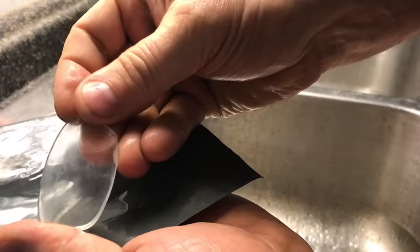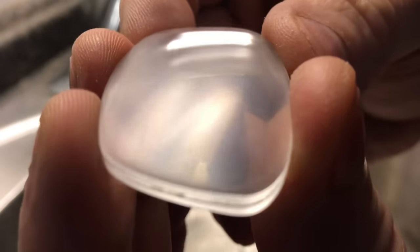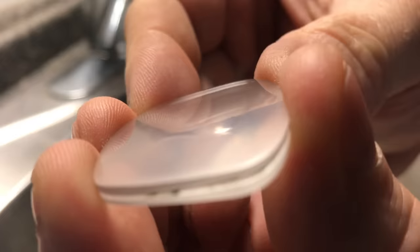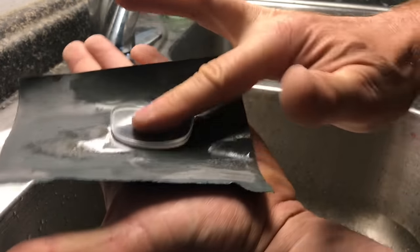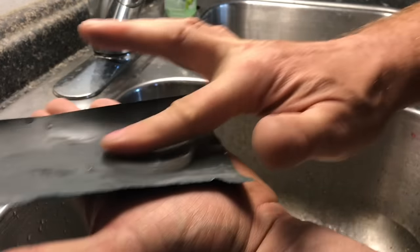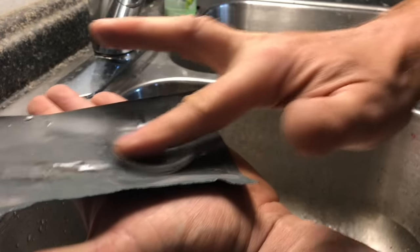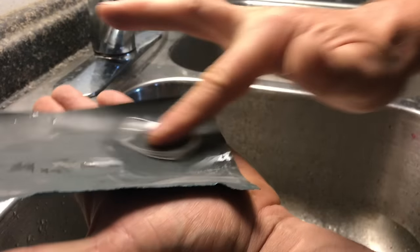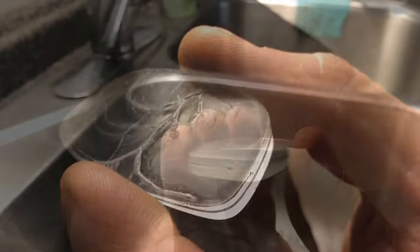Check consistency by pushing it into the palm of your hand. When we dry it off you're going to see that the scratches are a lot less, but there's a little bit of a haze over the lens. If you hold it in the light you can see there are far fewer scratches. The outside of the lens usually has the deepest scratches, so work that until there's no scratches left. If you want the sandpaper to work more aggressively, use a little less water. You'll be able to see the small plastic particles building up.